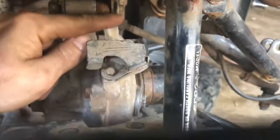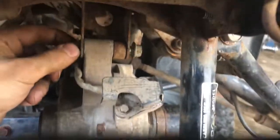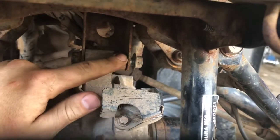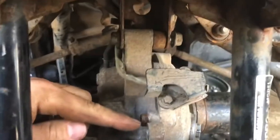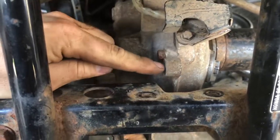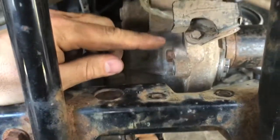Okay, so I'm taking out this bolt that we have up through here, the upper one that's holding the differential in. Just want to point out there's a spacer in here. Make sure that it stays on the right hand side when you reassemble everything so it all lines up. And then if you tilt down a little bit, I just took out this bracket down a little more that was right in here. That one held on to the front differential bolt. Got that out of there, so we'll be able to move that differential when the time comes.